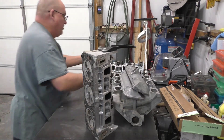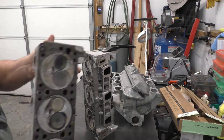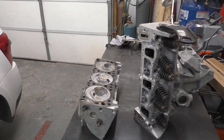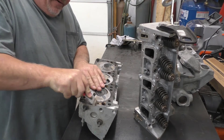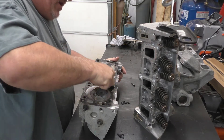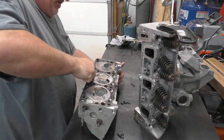Here's the other head — nice and clean. I will do this part here just because we can. Fast forward, guys, if you don't want to watch it — there's a slider on the YouTube video so you can use that. I get a lot of comments about talking, so you know — get over that. This is graphite here — we don't want to grind on that. We want to scrape what we can scrape and then use a surface conditioning disc to do the rest.